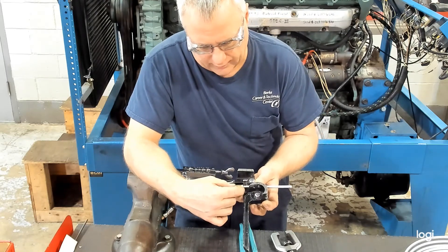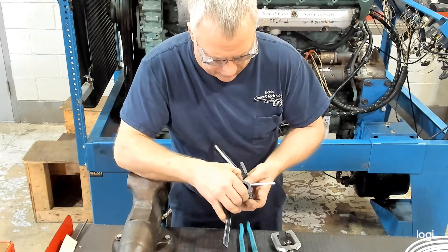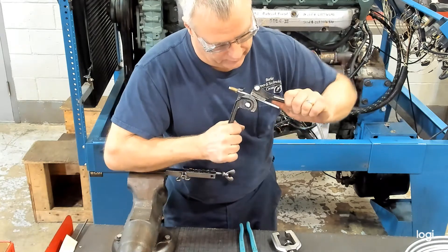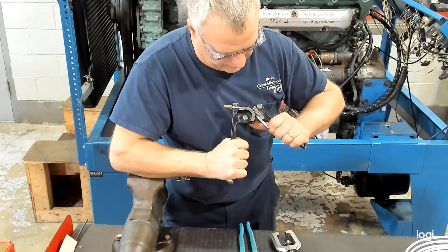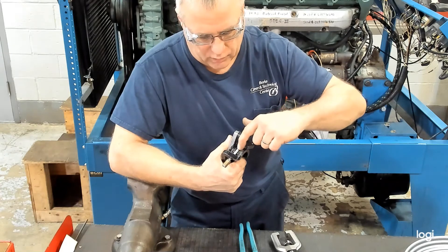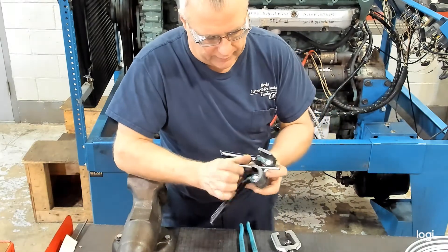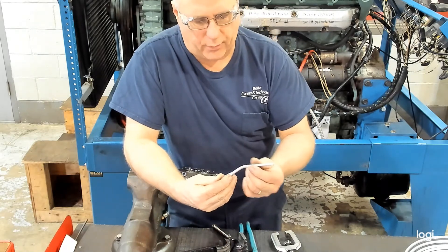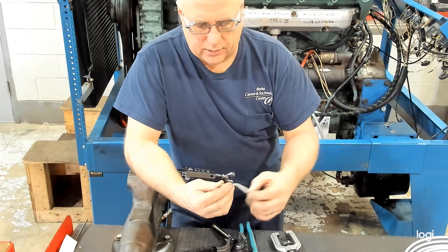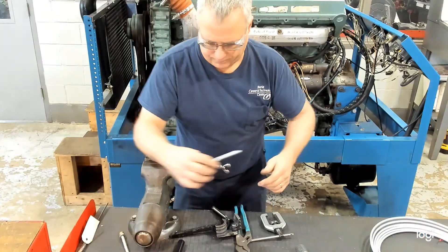I'm just going to bend this one at about two inches, so the mark is aligned with zero. Let's say I want to bend it 30 degrees — that's what you'd need to get around a certain component — but we'll go 45 because, well, there we go. With the tubing in the proper size groove — there's 3/16, quarter inch, 5/16, and 3/8 — that bent it to a 45 degree angle. That's what it looks like: a nice gradual bend, proper angle, it's not kinked, and fluid can flow through there unrestricted. So that's double flaring and bending of steel tubing for brake lines and fuel lines.